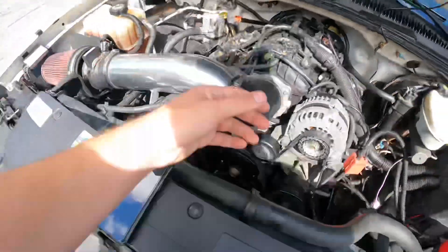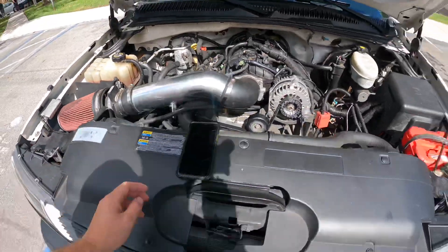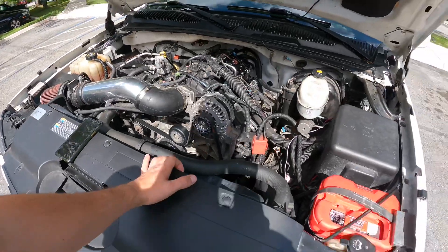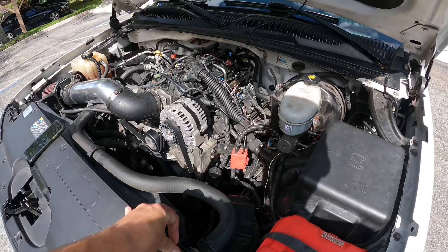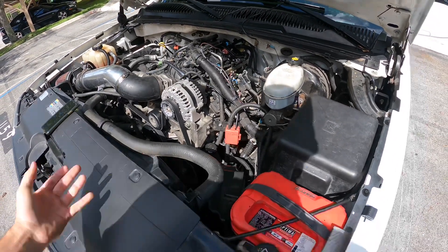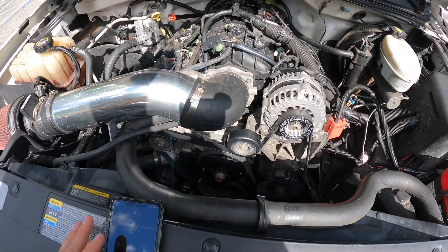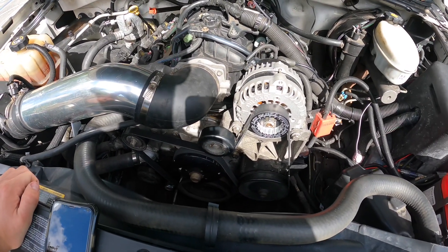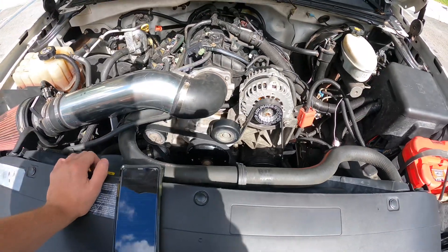The cold air intake is dumb — at lights I'm getting like 105-degree air intake temps. Driving it's around 85, so it's never actually cold. As for the 799 heads, they're stock — all I did was upgrade the springs to support the cam. The cam is a Comp Cam: 235/243 duration, .620 lift, 113 LSA. It's supposed to make power up top and doesn't have too much bottom end, but it pulls pretty good.